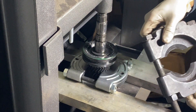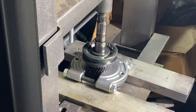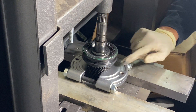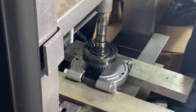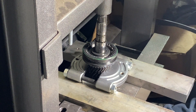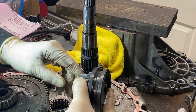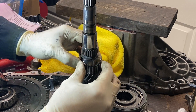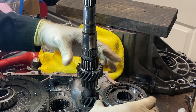So remember on the bearing separator there's two sides - there's the cone side and then there's the flat side. On this smaller one here, we're using the flat side. We're going to push this guy, and it's the hub that's pressed onto the shaft. This gear is free running so it should have needle roller bearings in there. That's third gear, and then this is the synchro between third and fourth. Don't forget to grab the shaft underneath so that way it doesn't go falling.